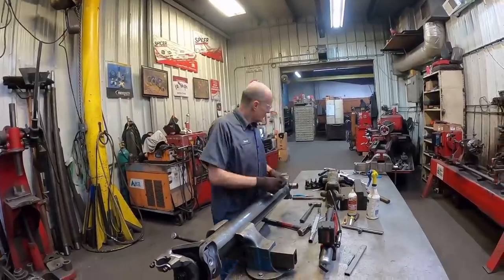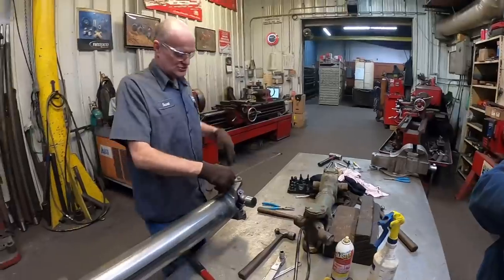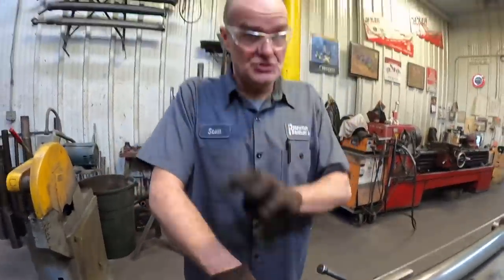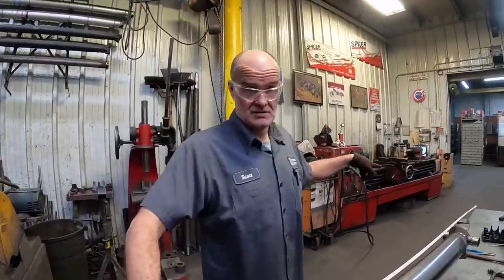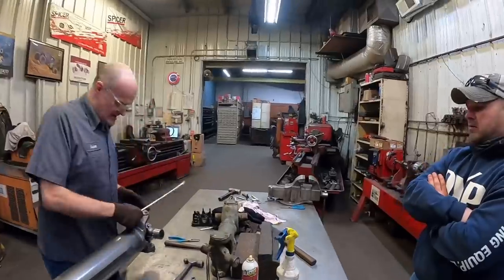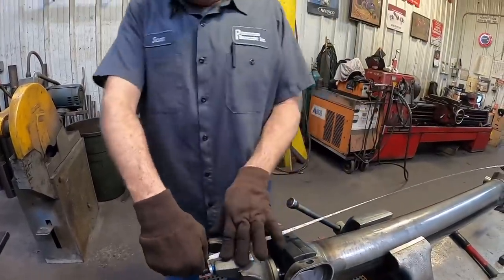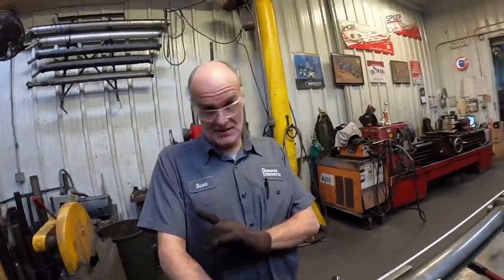So real quick here. Our measurement right here, this should be 17. We're going to say 17, 18 inches center to center. So if we go 18 inches to right here, this is going to be 68 inches. But then plus the other 2 inches, it's going to make us 70 inches cap to cap. Yep. Awesome. Even going with 18 inches, we're right on the money. I mean, right there at 69. If we're a half inch off one way or another, it'd be perfect, cap to cap.